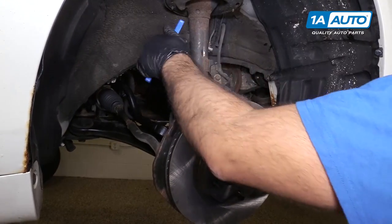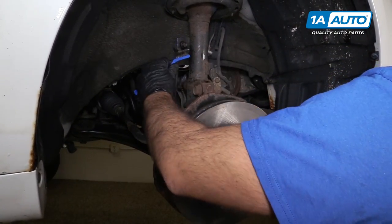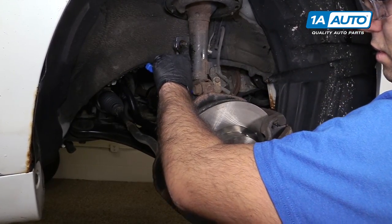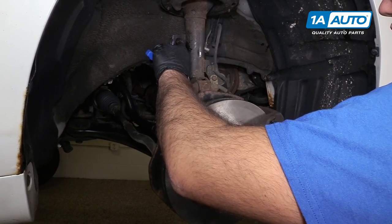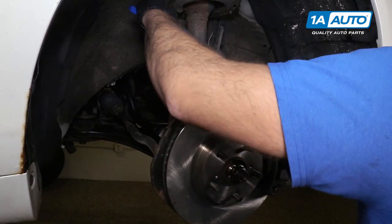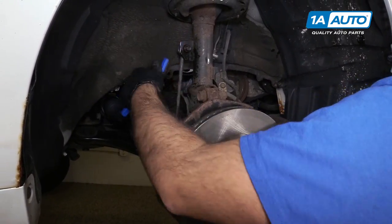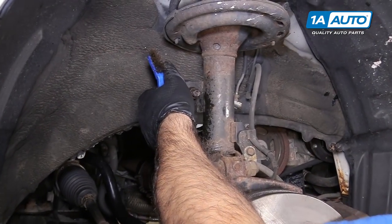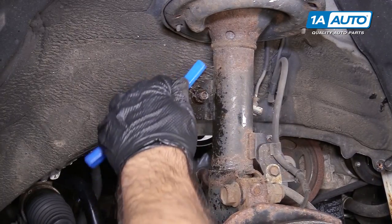These can be difficult to take off — they get rusty and then the ball joint spins. It does have a hex spot here to put in a six millimeter hex drive. A lot of times that strips almost instantly as soon as you try to break it free, and you end up having to put vice grips behind to grab onto the ball joint because there's no point here for a wrench.